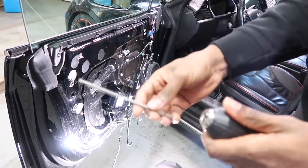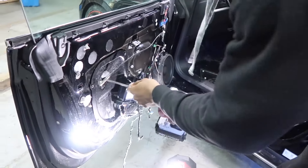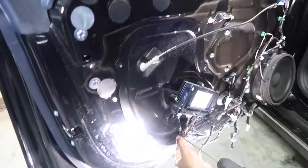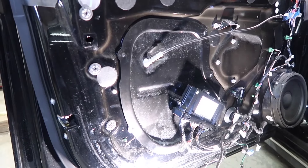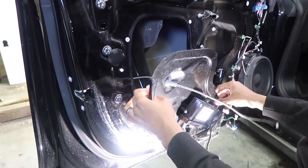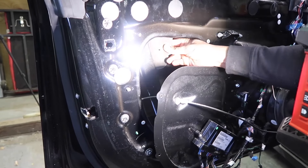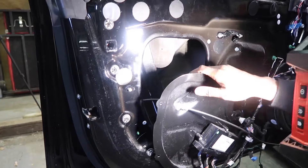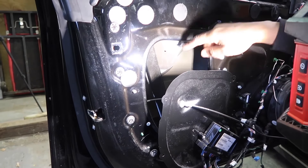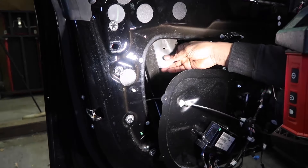That's what the back of the door panel looks like. This is a T20 — I'm gonna put it in this drill. The newer cars I believe are T25s, so just keep that in mind. I definitely broke something — oh look at this. This little rubber seal for the door is falling off, and this happens very often. For the cars I've taken apart so far, this little air shield has fallen down the door like a tiny little burrito. What happens is, as the car gets hotter in the summertime, there's a rubber seal that goes around that, and once it heats up it gets a little more loose and tends to fall down into the door itself.